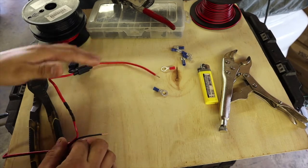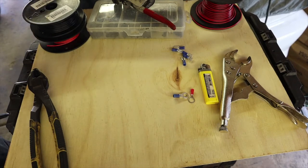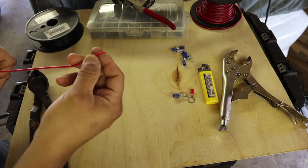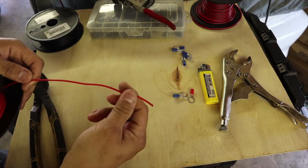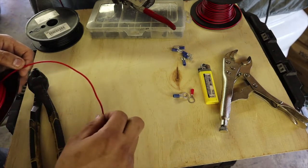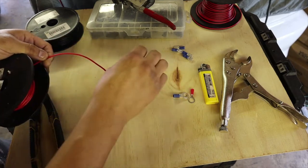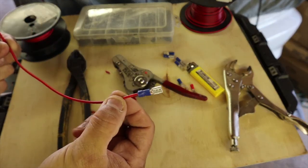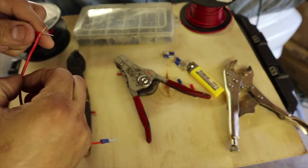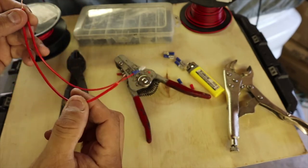Next, make a small wire to connect the horn to the relay. Grab a single wire about four inches long, snip it, splice it, and put female spade connectors on each end. For the lead that connects both horns to the relay, put a female end on one side of each wire and twist the two open ends together — one end goes to the air horn and one goes to the stock horn.